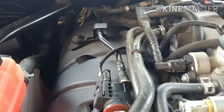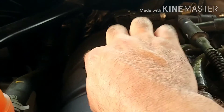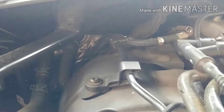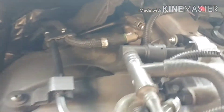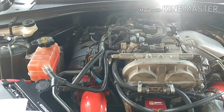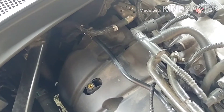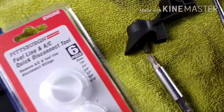The first step — when you pan over here, you can see this is an EVAP line. We've got to take this out of this crimp, and this is a T30 Torx bolt that we're going to be removing. Once that's removed, I'm going to get in here to our fuel line, remove that clip, and use one of the little disconnect tools to break that fuel line apart. The EVAP line bracket came off relatively easily — I just used a quarter-inch drive ratchet with the T30 Torx socket. She came right off.